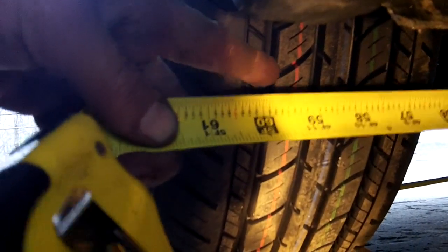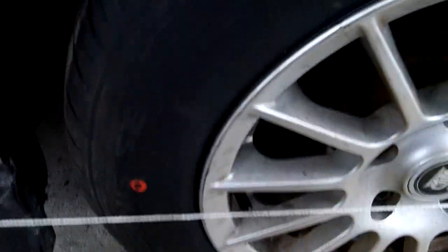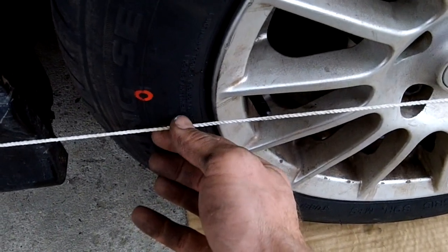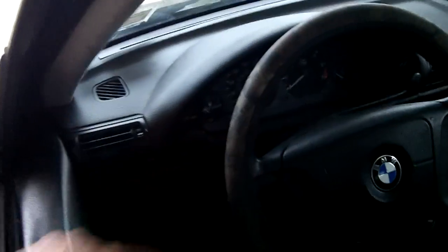Remember when we set this up, I made the tie rod ends about the same equal distance to the ones I took off, so that really got us pretty close. But we could go out in the back a little bit. As we stated before, this tire here is a little snug right here. If you pull against the string, there's no slop there. But this tire we got a little bit of movement. So what I'm going to do is adjust this side, turn in a half and do a remeasure — that'll kick this thing out a little bit. Maybe get us in toe and we'll be good to go. The steering wheel is still straight. Not splitting atoms here, but let me adjust it and see what I get.